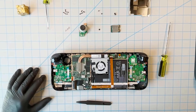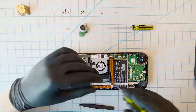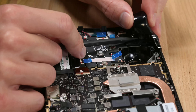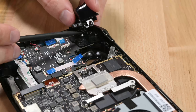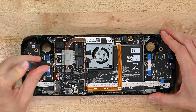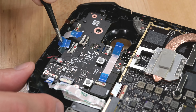And that's as far as Valve's teardown went. We went for the springy trigger buttons next, because they looked easy, but taking out screws and stabbing around angrily with a spudger didn't do anything. It took us a minute to figure out where to stab — the triggers are clipped into these little plastic hinges. Working our way from the outsides inward, these little button input boards are next: four screws each, plus 13 cables to disconnect, but again, all labeled.